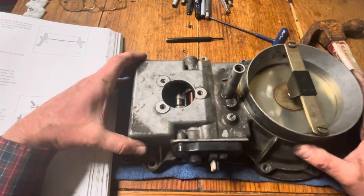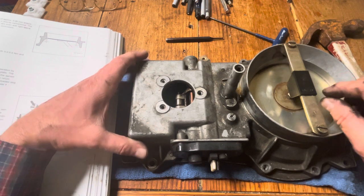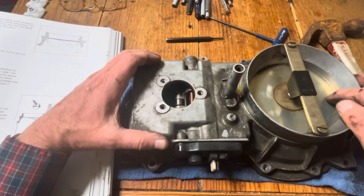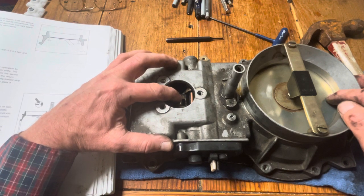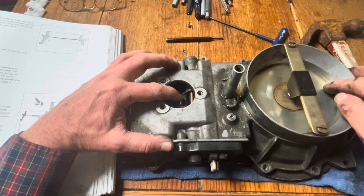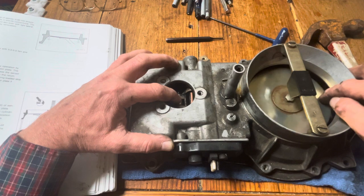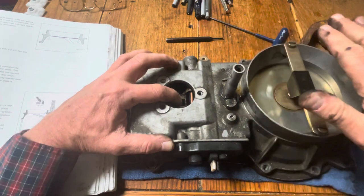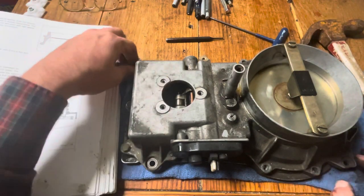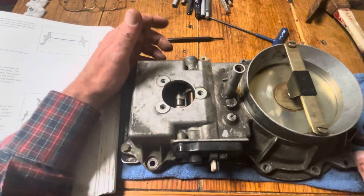The resting point — if your resting point is higher, there is so-called play, meaning when you push this plate down there should be a tiny gap between this ball and the piston of about a millimeter. The higher it is up, the more play there is, and there's no fuel flow as long as it moves down. But when you adjust it like this you will have immediate fuel flow and the engine is going to rev up every single time. However, this plate is no longer level, so it won't work 100% or give optimum performance.